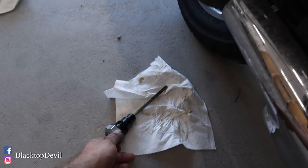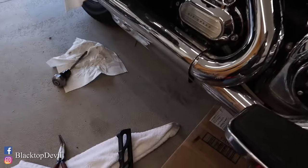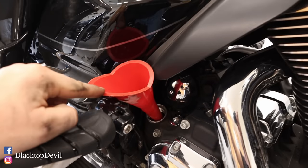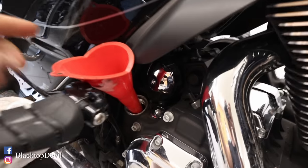I always set the dipstick on a clean towel. I have one of these long funnels with a little cup — I'll try to find it on Amazon and post a link in the description. If you have a service manual, it says to initially put in three and a half quarts and then check from there with your dipstick. You do a cold check first, then ride it around, get it hot, and do a hot check to verify your levels. In my experience with this motor, I've always had four quarts exactly in it.